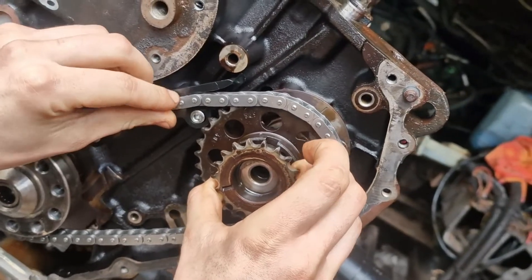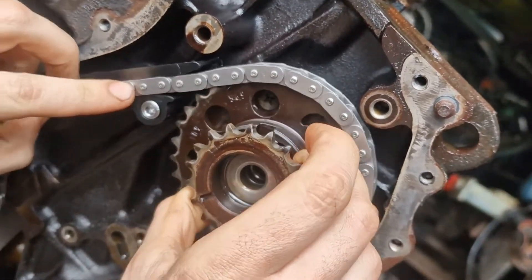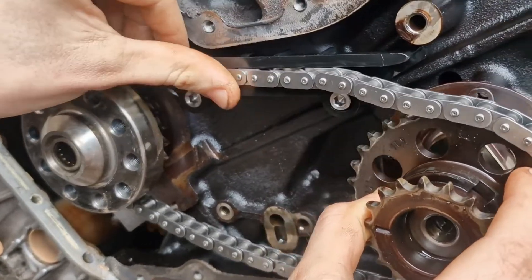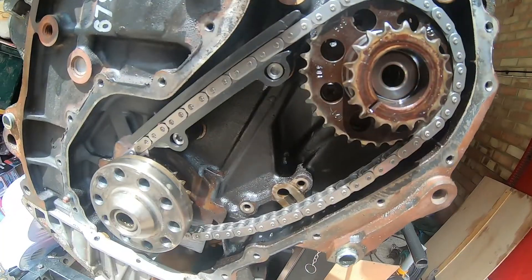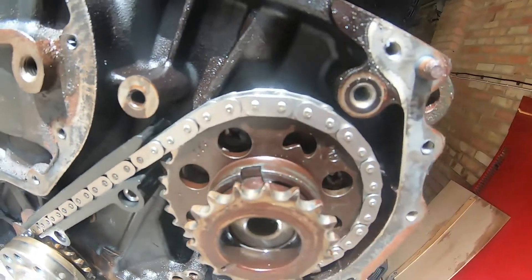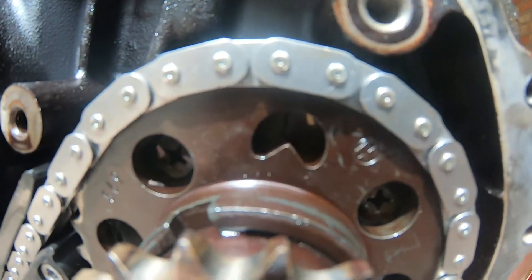You want to ensure that the oil pump has the flat part at the top, so that the little arrow lines up with the line on the oil pump. It may take a few goes of trial and error to ensure that the arrow lines up with the line on the oil pump. The top part of the chain just feeds through the guide, but there is still a little bit of adjustment to be done — it does take a few attempts. Now we've got the chain on, you just want to make sure that all the slack is on the bottom and you've not got any slack on the top. That arrow in there lines up nicely with the line which is inside.